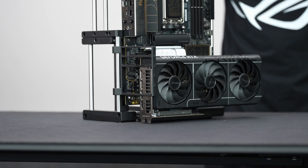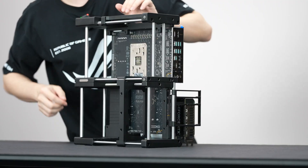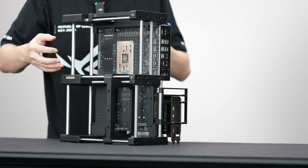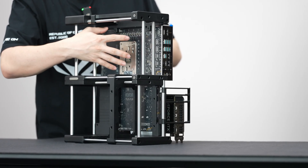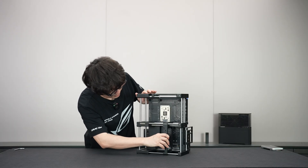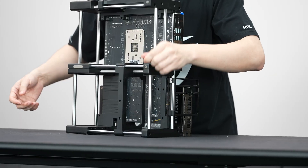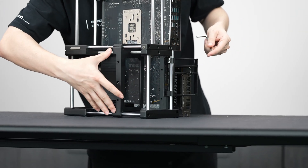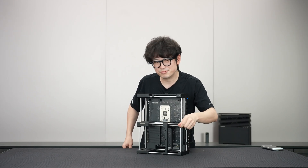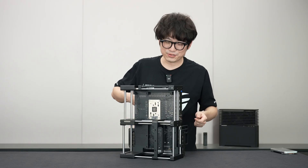The morphological transformation of this stand is quite interesting — at least it's pretty fast. The back of the unit looks like this. The space above is left empty, mainly so that when installing various radiators, there are buckles that need to be operated from the back. The power supply goes underneath. Its position is adjustable via a movable baffle with a guide rail and a hex wrench to shift the power slider, achieving compatibility with power supplies of different lengths. These screws make an unusual sound because the screw thread on the slider was handmade and is slightly off — so this prototype is a little uncomfortable.